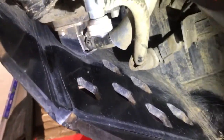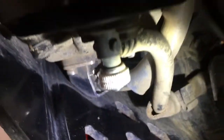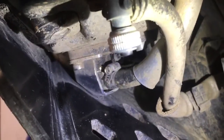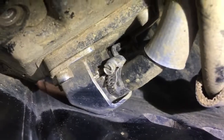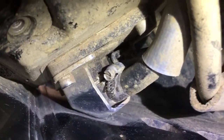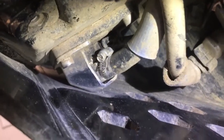This is the AXP plate left side fuel pump, under the left side of the tank for the 790. You can see that fuel pump guard is practically touching the plate. If I take a hit here from underneath, that energy is going to transfer straight up into that guard and possibly bust or shear off the bolt and the mounts to the plastic tank.